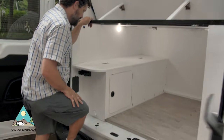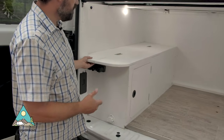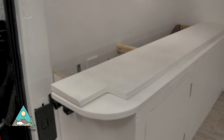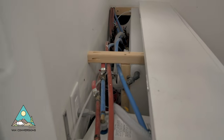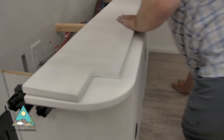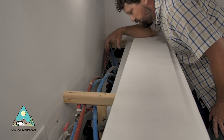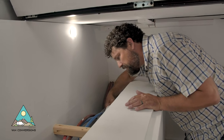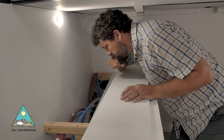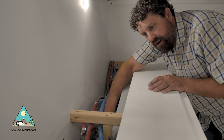Moving down below that is the utility room of the vehicle — this side is all the plumbing. I made a full-length flap to flip up so you can access all the plumbing if you have to winterize it or operate some valves. We have a 33-gallon fresh water tank tucked in there, plus some valves that can hook up to an air hose for easy winterization by blowing out the system. There's a fresh water hose next to the water pump and accumulator tank.